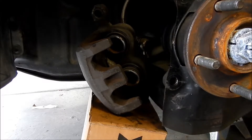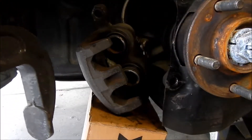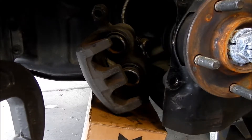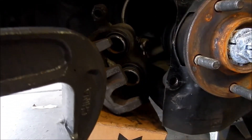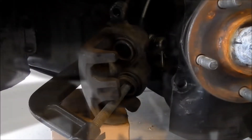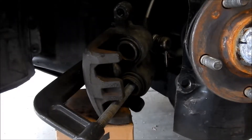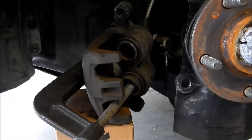Now, I don't know — I know what we can do. Just to make sure that other one... it looks like this one is stuck. It needs to be rebuilt. What I can do is stick a clamp on this one. I know these dual piston calipers are a little pain in the ass anyway. I'm going to stick the clamp there and tighten it a little bit, and then we'll see if we can get this one to pop out. Okay, so I got the clamp on there. I pushed the piston in just a little bit — wasn't too hard. So I have a sneaky suspicion that one piston has seized. That sucks.